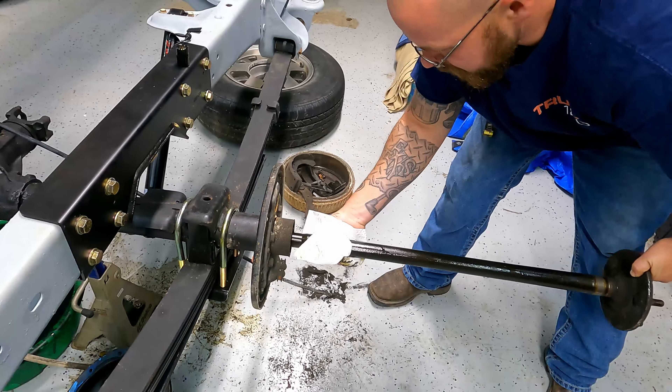We're going to go back in time and show you how I chose to do it. We've got to take this backing plate off because it's now worthless. There are two ways of doing it: one, we can cut it off, which is what we're going to do. Or two, you can drain everything out of your differential, pull your axle, unbolt it and slide it off. You're not going to want to do that in your driveway, so we're just going to get to cutting.